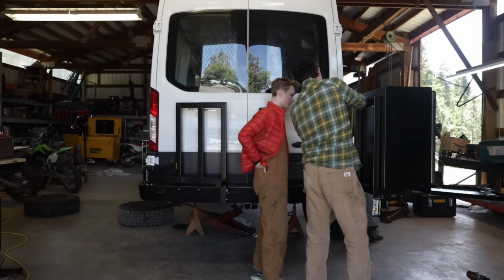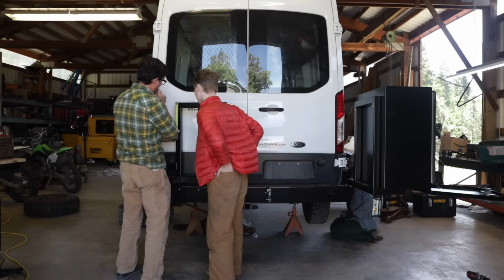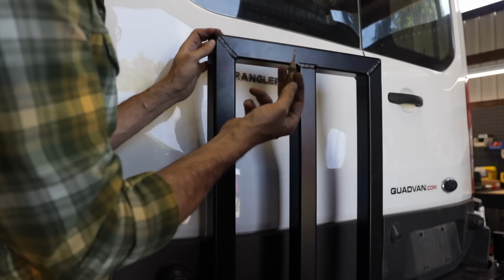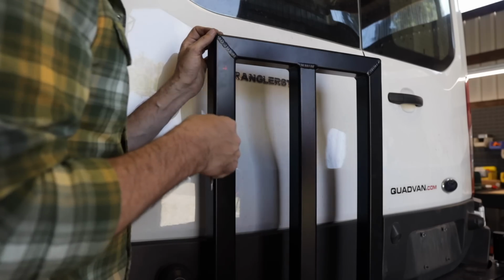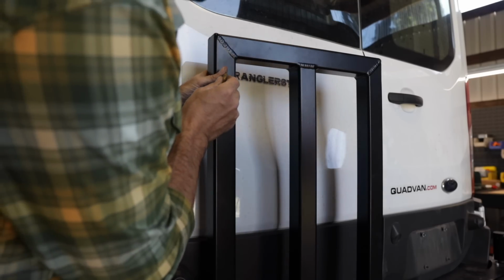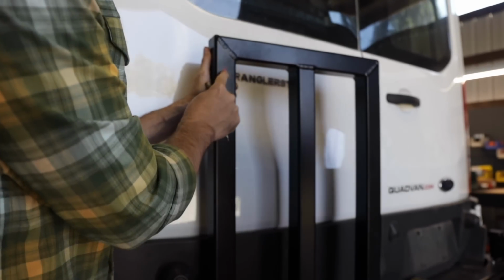So 3 inches here. So what I'll do is this. I'll come down 3 inches, and then the center, 1 inch. We know it's there. So this is a spring-loaded center punch. If you put a drill bit on a flat surface, what typically happens? It goes and spins around everywhere. It crawls all over the place. So what I'll do is I'll put this right in the center here. It's got a hard tip on it, and then I'll press it. And that's got a spring-loaded deal, and that makes that punch in there.